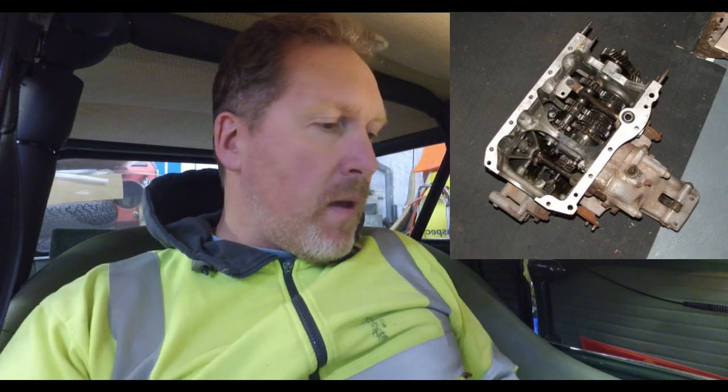It's a big but — it had a less than optimal gearbox under it. What it was, was the 1128-style Magic Wand four-synchro box that I had converted by Guessworks into what they call the hybrid box. That uses A+ gears in it, and I think the final drive was supposed to be 2.9 or 3.1 on a twin-pin diff. Although I did think I didn't get the final drive ratio I was expecting, because the speedo was always miles out. I did some checking with GPS speeds against revs, and using the spreadsheet on Guessworks' website, the final drive I thought I had and the one most likely in the car didn't match.